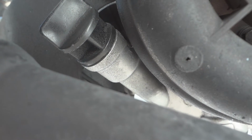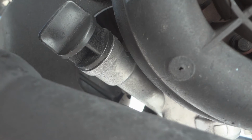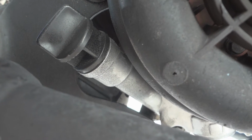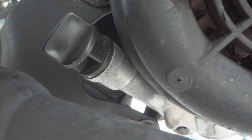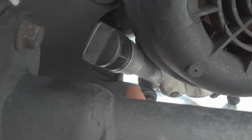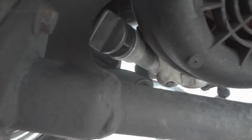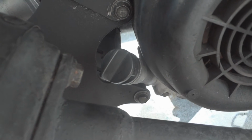when you look at it closely, you can see a gap between the plastic and the aluminum now, because those two gaskets that you cut out are helping to push down the rubber seal more so that it will do what it's supposed to do, which is to seal. Otherwise, you'll find that oil will be blasting out of there when the motor's running. You'll see it dripping down here and running underneath the motor. So that is the hack for that.